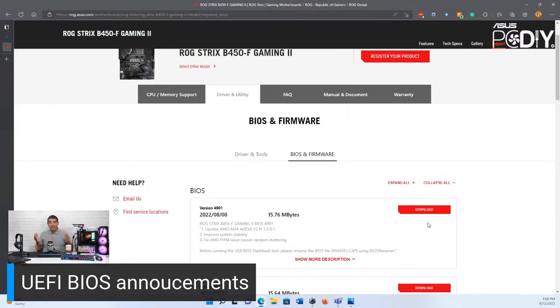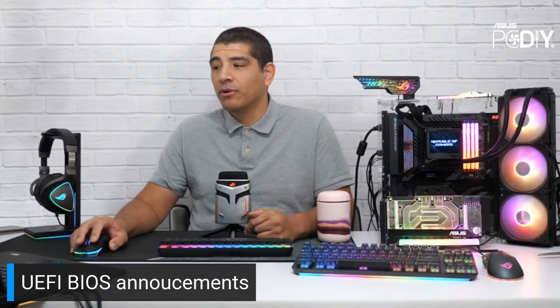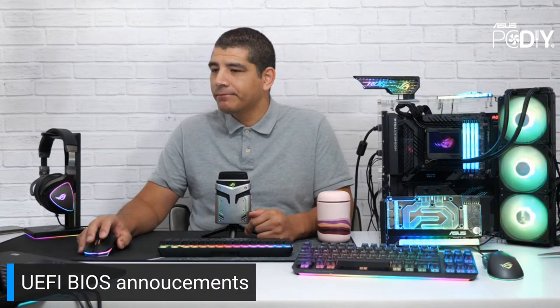As always, keep in mind that if you update to a much newer AGESA and you're running a much older AGESA, especially if you have any special overclocks, you may have to retune your overclocks to be in alignment with the new AGESA, because there can be changes in what are called auto rules and other parameters. So again, we have this all covered in a full FAQ guide in our ASUS PCDIY group. If you're interested in that, make sure to check out the group. It's linked in the description, and it's a great space to get more information in this regard. Okay. All right.